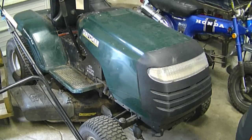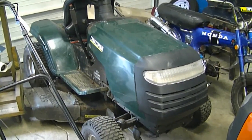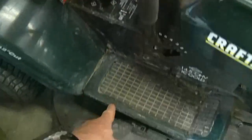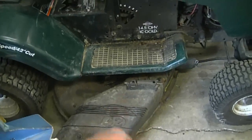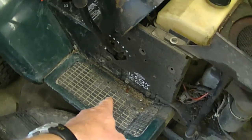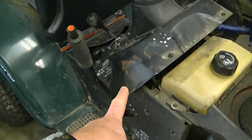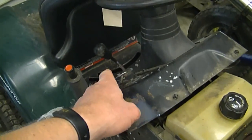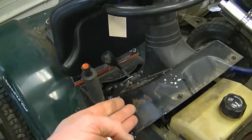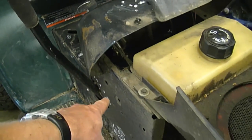A question I got the other day about this tractor here is: why do the blades keep turning when I disengage them? On this tractor, the lever to engage the blades is right here — you bring it up, it engages the blades, and you can mow your grass. This tractor has a cable from the lever inside to the deck that basically drives the pulleys back and forth to engage the deck. Now, if that cable gets rusty inside, you're going to disengage the blades and they will keep turning because the cable isn't moving freely — it's seizing. The cable is hooked up right here and it goes to the deck as I've mentioned.